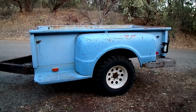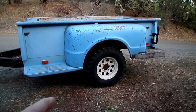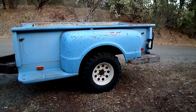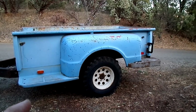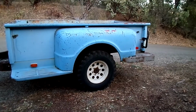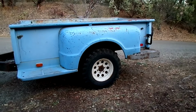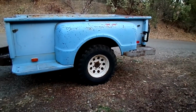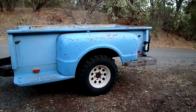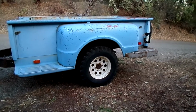But today it left here with a load, and this wheel locked up at a stop, and it freed up after a bit, and then finished my run. But on the way back with it empty, it would lock up at every stop, and it would roll reverse fine, but lock up going forward. So I just had to keep going back and forth until it'd start rolling again. Then at the next stop, repeat.